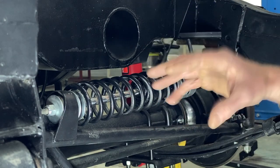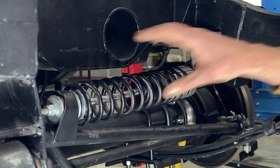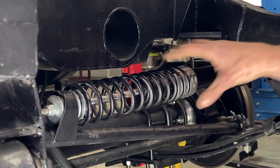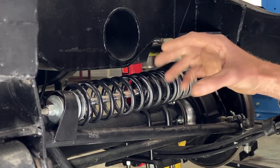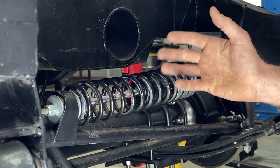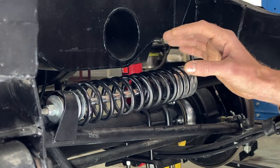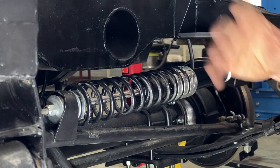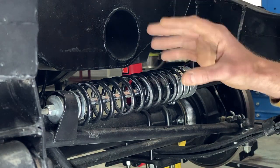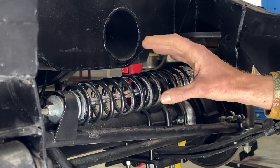But then people started requesting it. And so later on, Series 2s and then Series 3s all came with a steering dampener. So no spring, but the shock absorber system. That made the steering harder again. So that notoriously heavy, low-speed steering is partly to do with having the steering dampener in place. Of course, adding the spring and the return to center element makes that even harder. So if we don't have the power steering enabled, this is the heaviest steering that you've ever experienced.